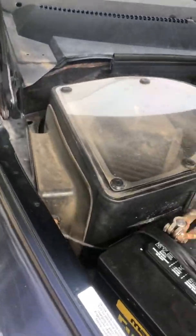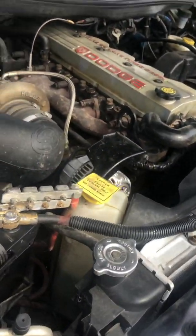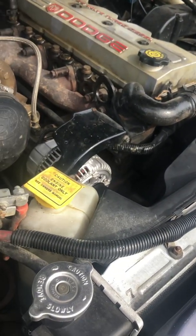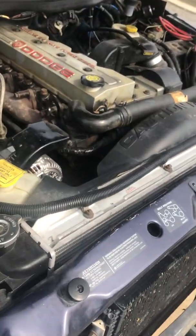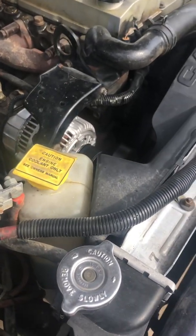Let me show you where the PCM is located — it's right there on your passenger-side firewall. Something you'll want to check immediately is that little wire right there, which is a ground wire. I'm going to trace that — it comes up here where it's secured to the cab. That's ground number one. You want to make sure it's working fine, because if you're having a no-charge or overcharge situation, we need to check the grounds. This truck was having an overcharge situation.